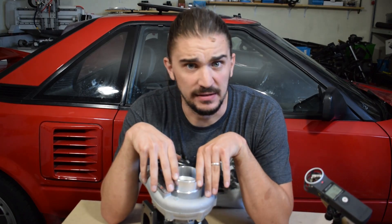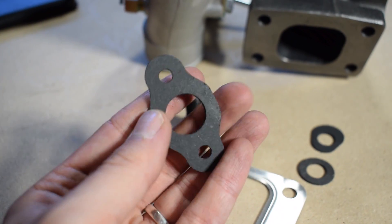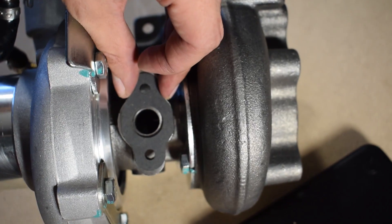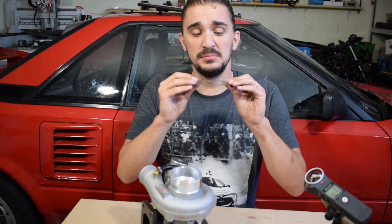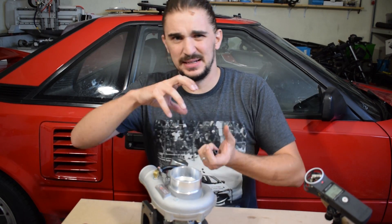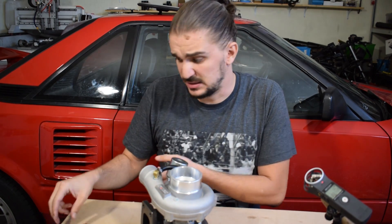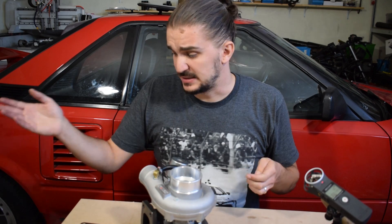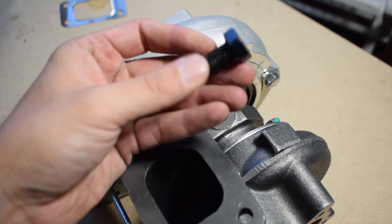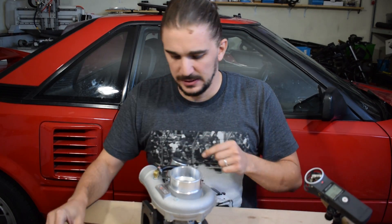Now there are some things I don't like about this turbo. When it comes to the gasket pack, honestly none of the gaskets look very reassuring to me. The rubber ones are kind of cardboard-y — maybe they're okay, who knows. This one doesn't seem to fit right on the holes, doesn't seem to be centered properly. This other one is kind of thin but is likely okay. To be honest, I likely won't be using these gaskets — there's no reason to fit them and then have to remove them if something leaks. I'll get some slightly higher-end gaskets, but it's a minor thing. At $120 they've got to save money somewhere. I also only got one banjo bolt in my kit — I think I should have received two — and the one I got seems to be too long for one of the holes and too small for the other, so I likely won't be using it either.